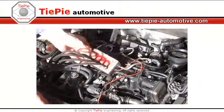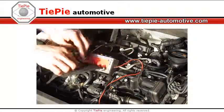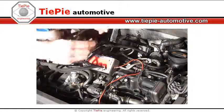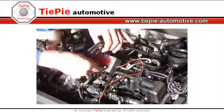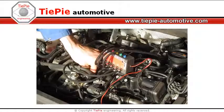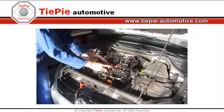Place the RFS400 and connect the injector return flow outlets to the RFS400 inputs using the hoses as shown. Connect the return line from the RFS400 to the return line of the engine so the return circuit is closed again. Place the RFS400 and its wires in an appropriate position in the engine bay, keeping it clear from any moving parts.